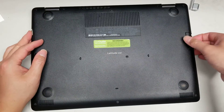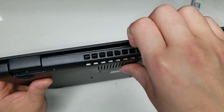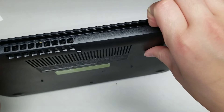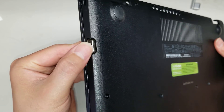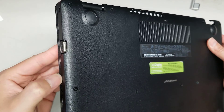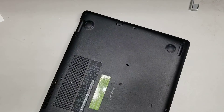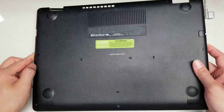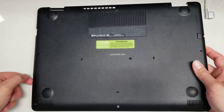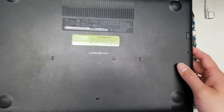Once you remove all the screws, just go on the side through the edge with your fingernails or a pry tool, and just pop up all the edges. On the side with the VGA port, it'll be caught there, so you don't need to pry that side up. Go all the way around, and then once you get all of it out, you can lift it at an angle and kind of wiggle it. If it's stuck, you can help pry it a little bit on the side, but it should come out pretty easily.